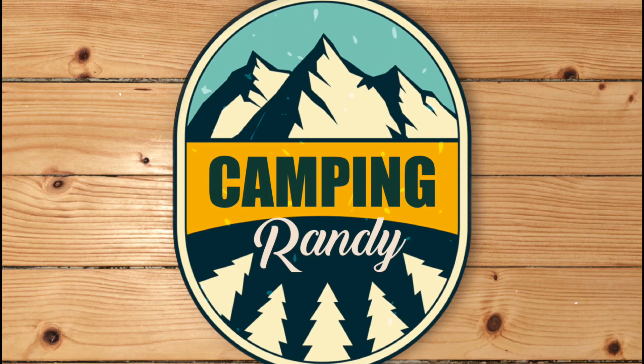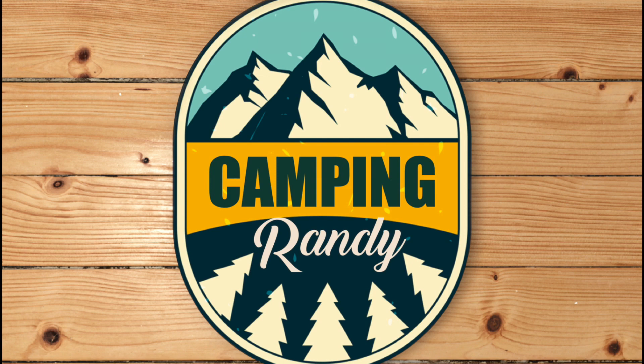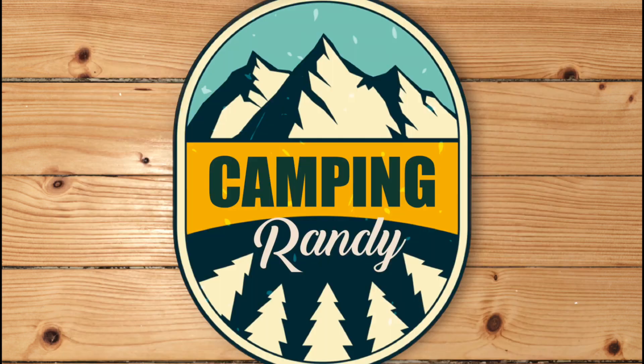Also, if you've been following John DZ and Manny, they've been working on the new 2023 Pilot Trail Sport front struts, which give you one inch of lift and an extra inch of travel versus previous versions. Those Trail Sport struts are different from the EX-L, Elite, and other trims - so if it's time to upgrade your Gen 2 front struts, I recommend you get the Trail Sport Pilot struts; they bolt right up. Manny and John DZ also have the Trail Sport front sway bar - there are some modifications to the mounts on the subframe, but the end links work. Check out John DZ's video from a couple months ago.